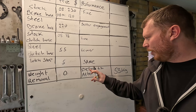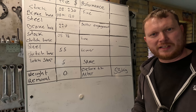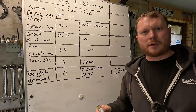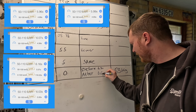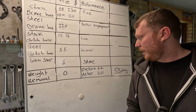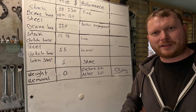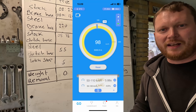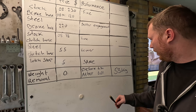Back from testing the weight reduction — I've been doing a lot of these 50-to-110 third gear runs, and pretty consistently it has been around 6.3 seconds in stock configuration. But after removing 53 kilos: 6.0 seconds. That's actually a lot better — almost the equivalent of slapping on some headers. I'm honestly super surprised. The best I was able to do was 5.88 seconds, which was simply unheard of and by far the best time I've ever done in this car.